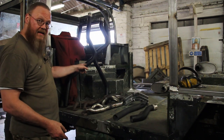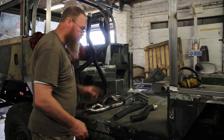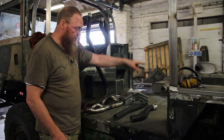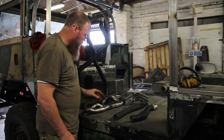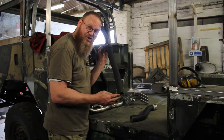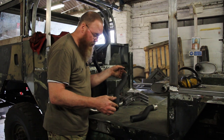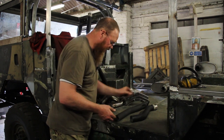So that's it, and you can see my X-pipe there as well, it's painted. The silencers are over there; the flexes were all stainless so they didn't need doing. I did take them to shot blast them so I could get a good etch, so that the paint will key to it better. I did that with all the mild steel.